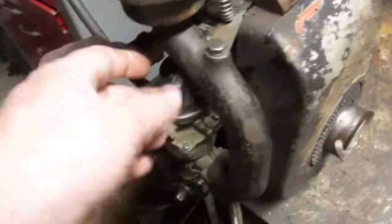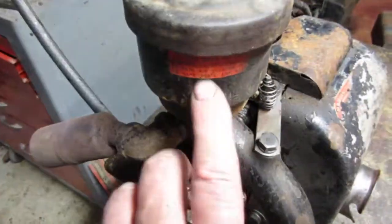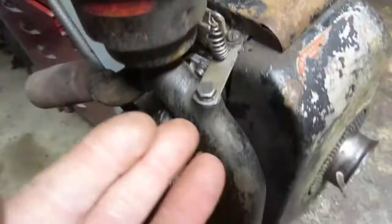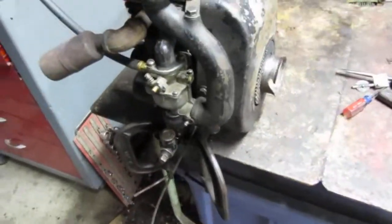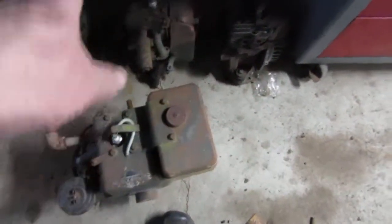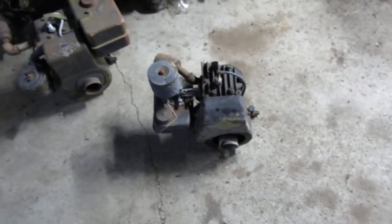I make my own gaskets — I find an old gasket, even for the gas bowl, trace it out and cut it with a knife. Same for the oil bath gaskets. I was surprised the tag was still on this oil bath when I found it. I didn't pay a whole lot for this motor. I've got two, maybe three more David Bradleys here — I think these are all 500 series — and then this gear reduction, which is a Model NPR6.